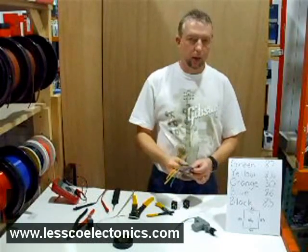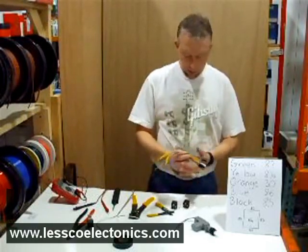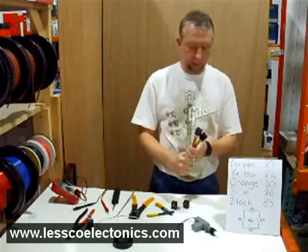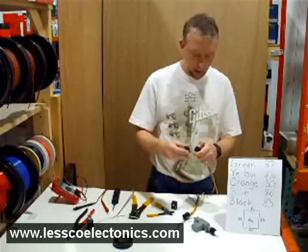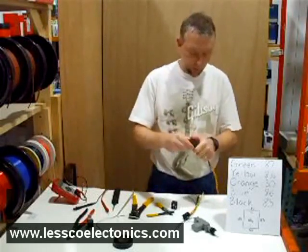In this video, I'm going to show you how to wire up power windows and power door lock actuators, or door lock motors. Optimally, I'd like to use a dual relay socket, but the one I have does not match up to the color chart that I have here, so I'm definitely not going to use it because it's going to confuse you. So what I have here is two standard single pole double throw relays.